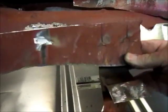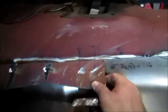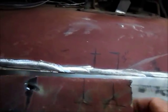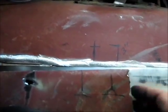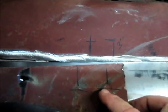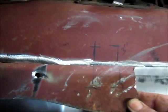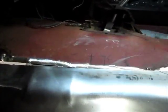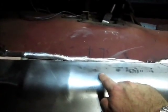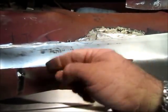What I was trying to show you was: before I cut this part, I marked it. I drew just an arbitrary line up here and measured — actually, I measured up three inches from the center of the spot welds — and I drew a line, and then I also put vertical lines that indicate where it was on the original. So that way, when I get the new pan in place, I can just drill those two spot welds, take this piece, and once I remove the old metal, line up the spot welds, hold it in place, and then weld it in.